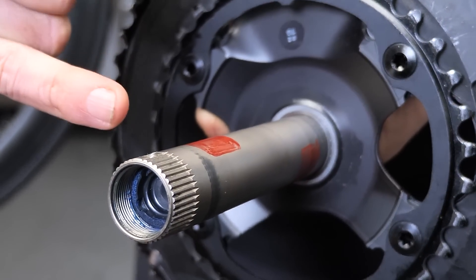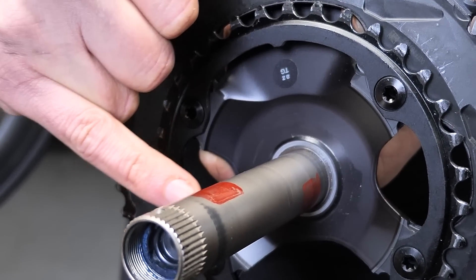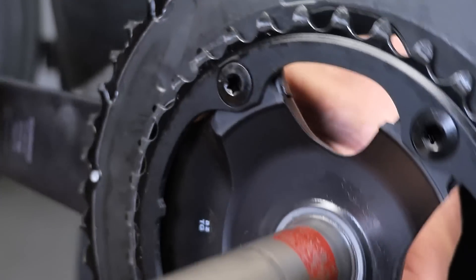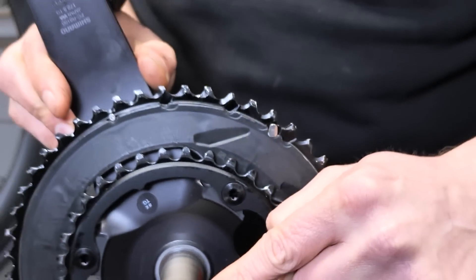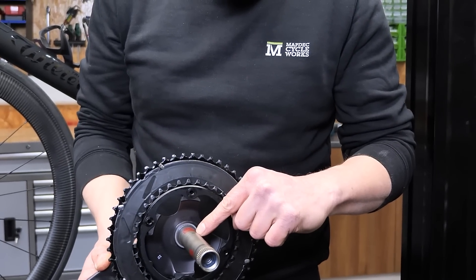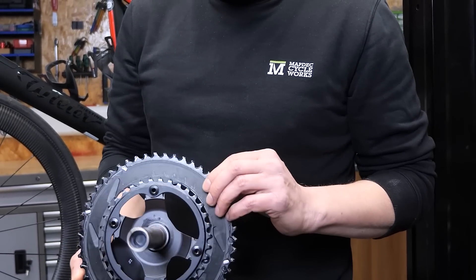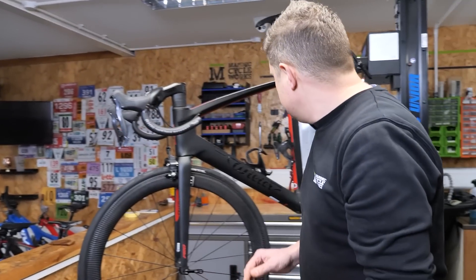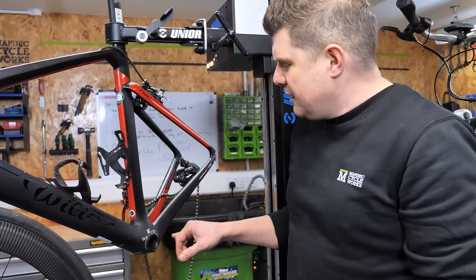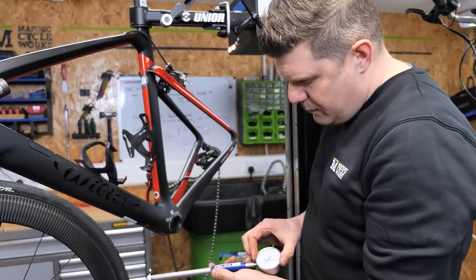You can see the witness marks of rotation where it goes light here and heavy here. This is a new crankset, so it doesn't already have witness marks on it. I've marked the red area on the drive side where those rotations are — you can imagine as we're pedalling it goes light here and then light here as well. So we have a bit of an alignment issue. These numbers aren't stupidly accurate, just to give you an idea of the average.